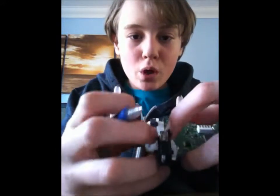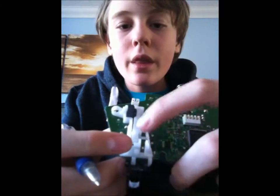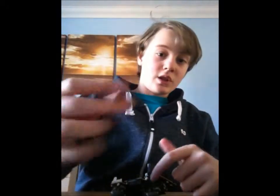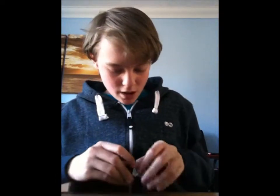There. Okay, so I figured it out. You want to pull that little flap and that little flap apart. Gently. Now be careful when you take it apart about the spring because they can fly off everywhere. Luckily mine didn't. And keep these close by, don't let them out of your sight, because if you lose them, it's stuffed. And then the triggers just come off. And the same with the other one. Simple enough once you know how to do it.